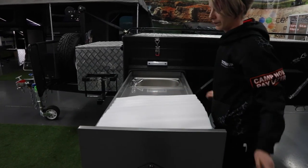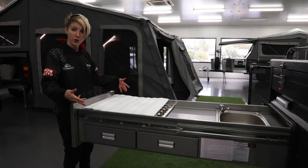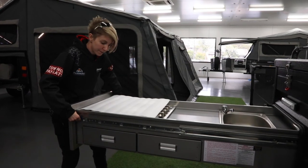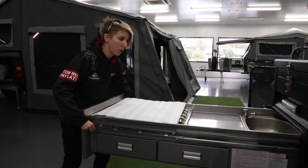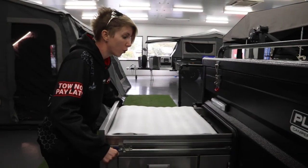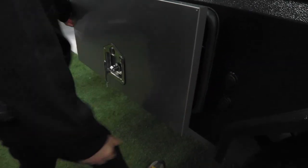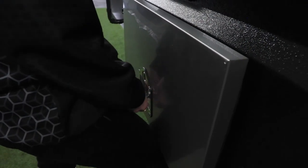The tap is plumbed to the onboard water tank and controlled by the pump, which you turn on via the power management system. Turn the handle to get water. There's an inbuilt drain plug — pull up the little gold piece to release water, and push it back down to seal. When finished with the kitchen, turn off the gas before disconnecting the bayonet hose. Once you remove it, replace the dust cap. Disconnect the grey water hose including the screw-on attachment. Let the burners and grates cool before reinserting the foam and sliding the kitchen away.